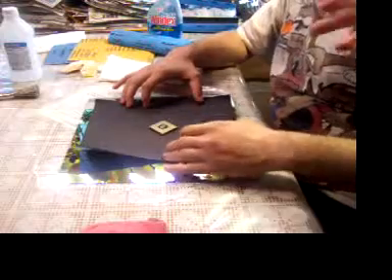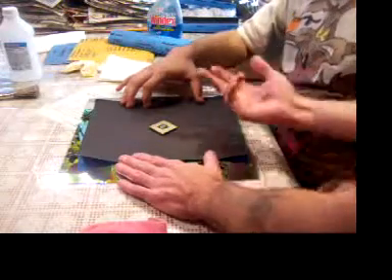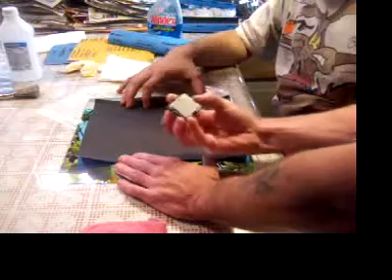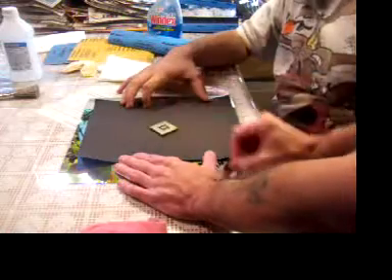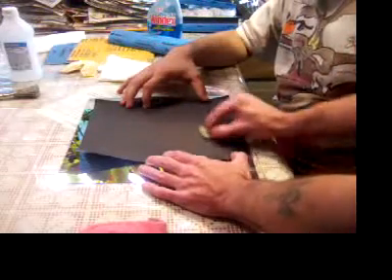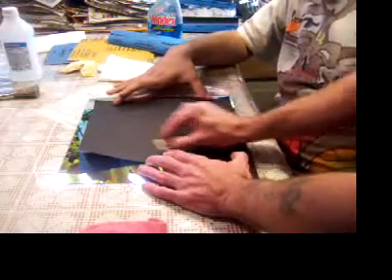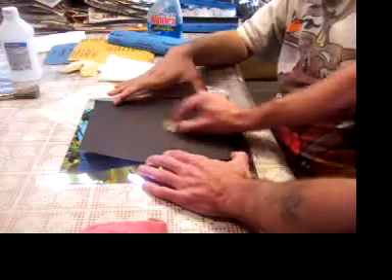This is a series on lapping the CPU. We're not going to use any water, oil, or special jig to lock the CPU down. All we're going to do is really simple dry lapping with wet-and-dry sandpaper. Take your hands — notice how I'm holding it between my two fingers, just the very edges. No tape, nothing on there. We're going to start off by simply using the weight of our hands, moving in two to three inch circles, using the entire piece of sandpaper. Rotate it — go counterclockwise, clockwise — just kind of mix it up. We're looking for a crisscross pattern.